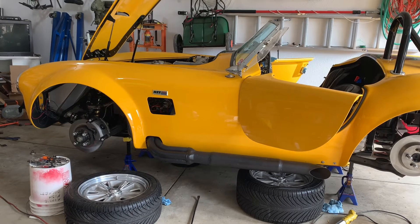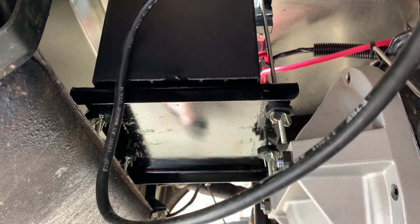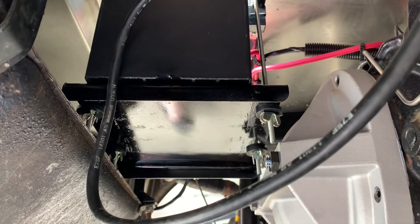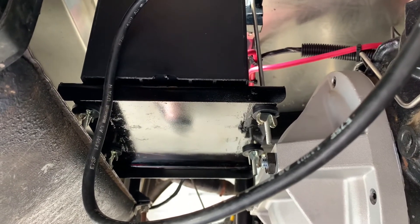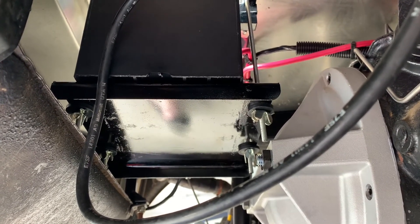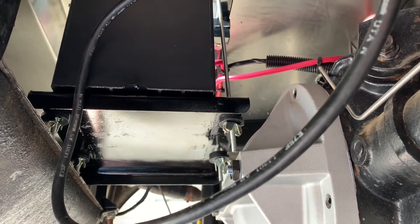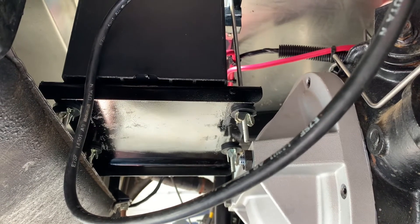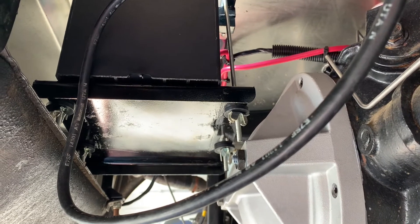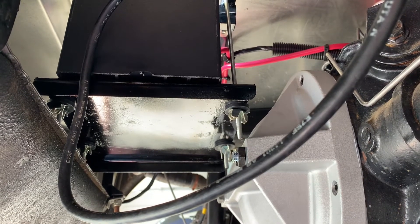Good news — just went around the entire car after pumping the brakes probably 30 to 40 times, holding good pressure in the system with a nice rock-hard pedal. Checked everything and it is dry everywhere. I think I'm finally past fixing brake leaks — very happy about that. I still just need to go under the dash and adjust the master cylinder push rod to make sure the end play is correct, then do a final bleed. After that I can hook up the e-brake cables to the handle, get those adjusted, and brakes will be complete.